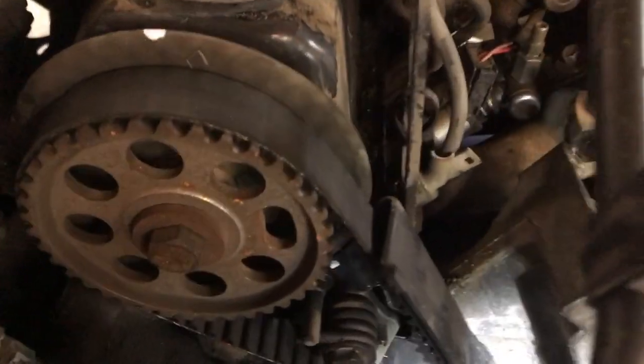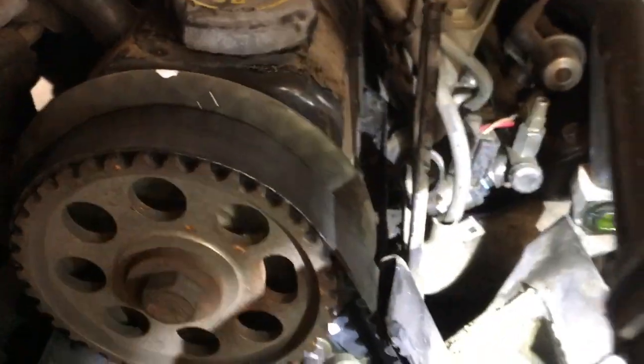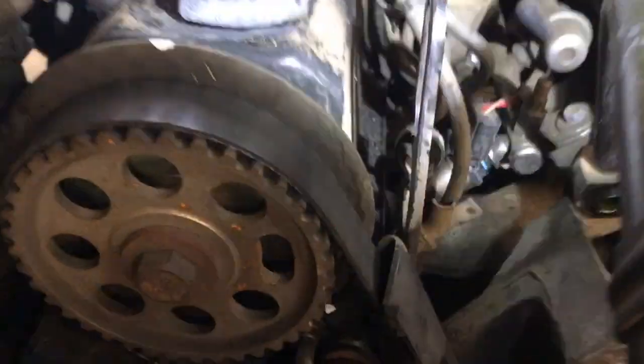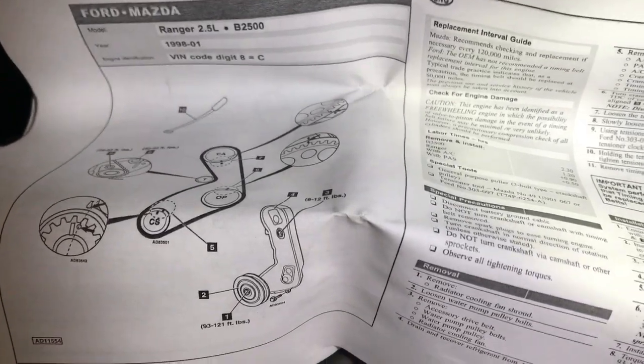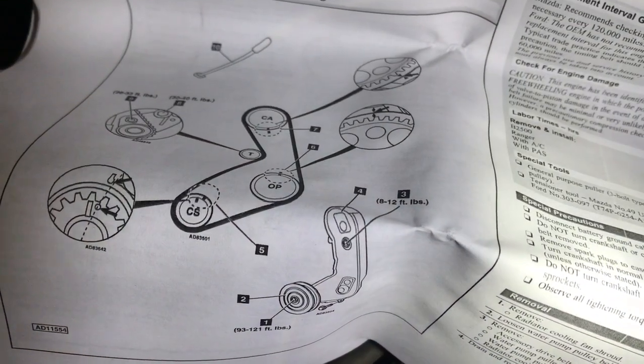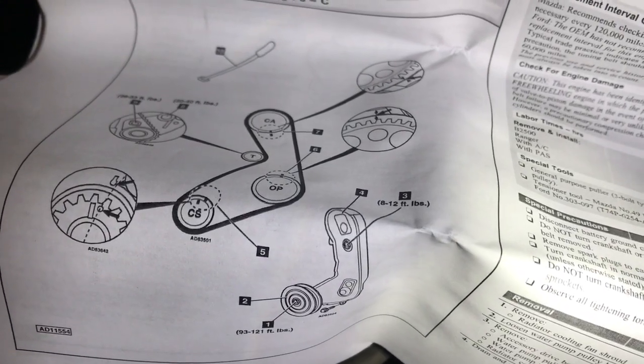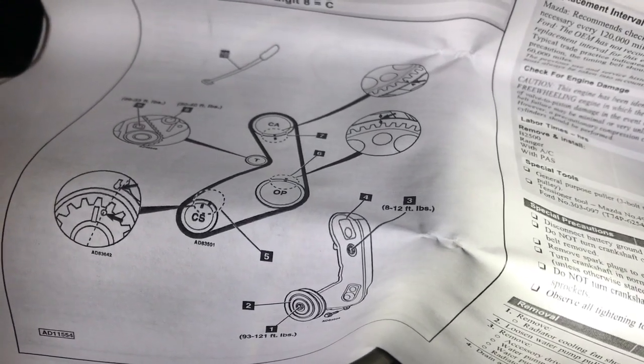Now what I went ahead and done is run this vehicle around to top dead center, and the way it came, it had some marks here. I had actually Googled it on the internet, and it shows you where your lineup marks are for your crank and your camshaft and your countershaft. Okay, and I always like to make my own marks as well.